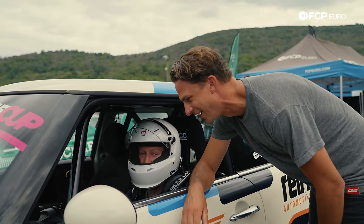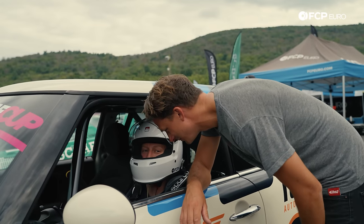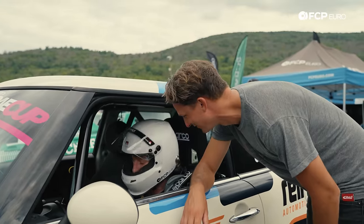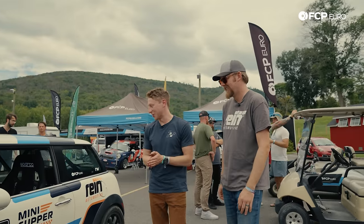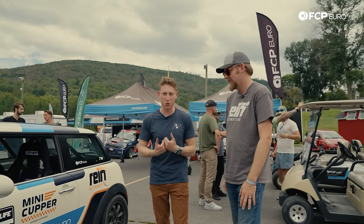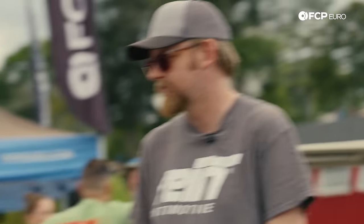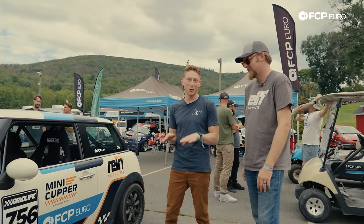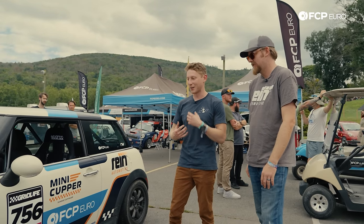All right, well, with a little more time in the car, I'm pretty confident that I could knock that weight. This thing feels awesome. It's so good. I'm blown away by this thing. The big factor here, I was just saying to these guys, is I'm used to torsion beam in the Fit, which means everything in the rear axle is connected, so it's not going to move independently. Whereas this being divorced, you can properly load it up. You're used to much better designed cars than I am in the Fit, but you can actually load it up, and that's where I'm having that learning threshold, learning how hard I can lean on this thing.